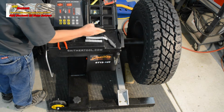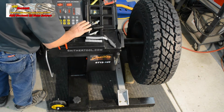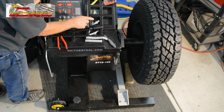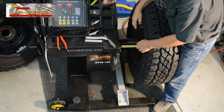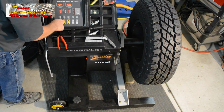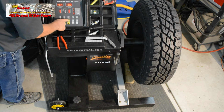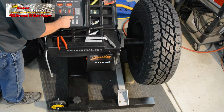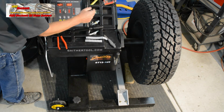A slight adjustment on this measurement. I've changed that to 13.5. It was a split. It doesn't seem to affect the weight. It was a difference between 13 and 13.5 inches. I'm getting a read closer to 13.5. Did a comparison on that. Didn't impact the balance, so the tires that were done at 13 are fine. 8-inch width on the rim, 16-inch diameter, commercial truck, not passenger car, but truck. These are large tires.